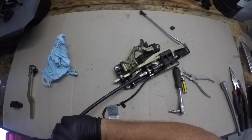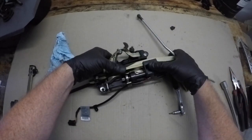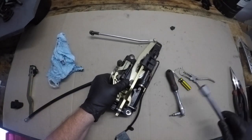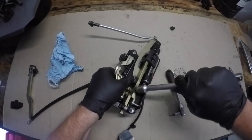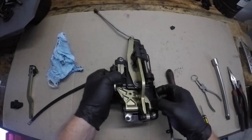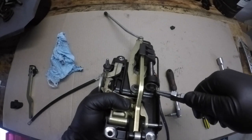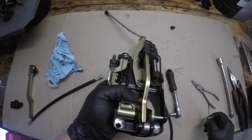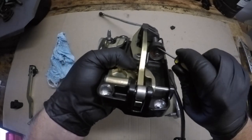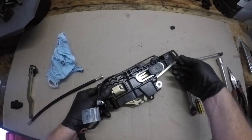Here it is just slowly winding in — we can see that threaded rod is pulling along the plastic part, which is moving that metal piece along. At this stage the circlip still hasn't been pushed back in, so it's just a matter of tapping it right back into the housing where it needs to sit. Get the circlip pliers and reinstall that circlip, making sure that it's fully located all the way back so that the circlip groove is exposed. Once you've got it all in, just check that it is locked in place and that the circlip is not going to pop out.